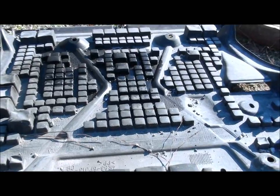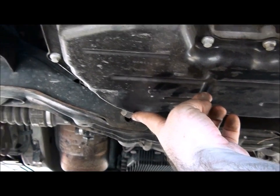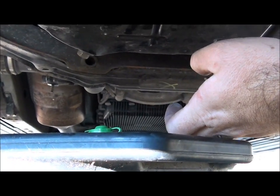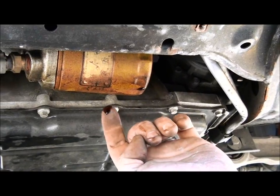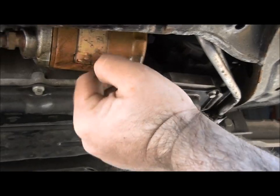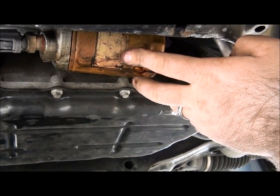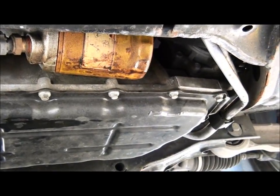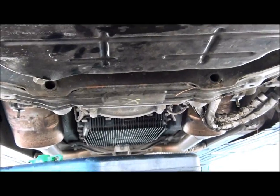Under here, the front pan — that right there is your oil pan. Towards the back corner is your oil drain plug. We're going to take that off and start draining our oil into the catch pan. I've got some oil drippage right here, which is probably where it was coming from on my belly pan since this is right in the vicinity. It looks like it just kind of sweated off here. I'll double check to make sure there's no leak above coming down onto the top of the filter and dripping onto the belly pan. After draining, we're going to check the transmission area too.